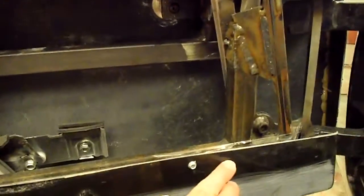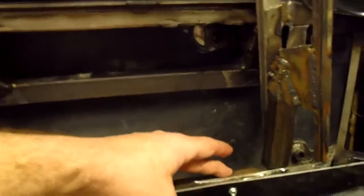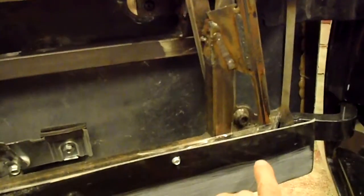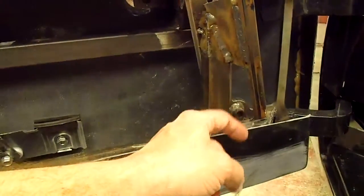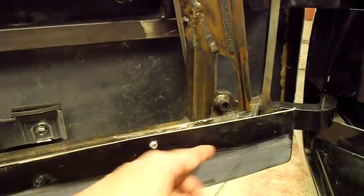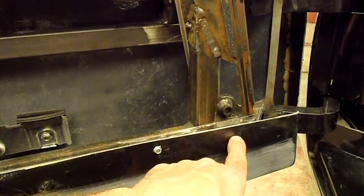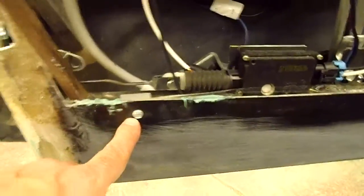At the bottom of the door, what I'm going to do is put nut inserts in the 1-inch tube, and then I will put a bolt through here. There's actually a little bit of an air gap behind there, so I can use washers to push it in or out. And if I have to, I could always slot the hole in the fiberglass so I can move it front to back. I'll do the same thing back here.